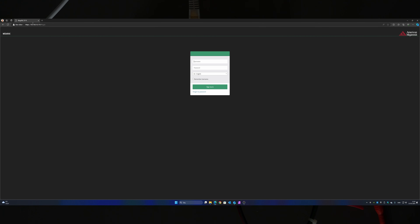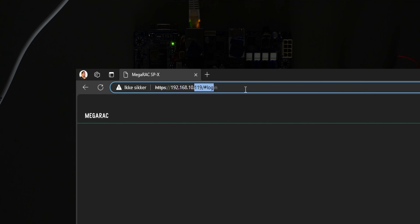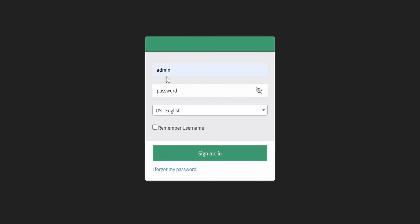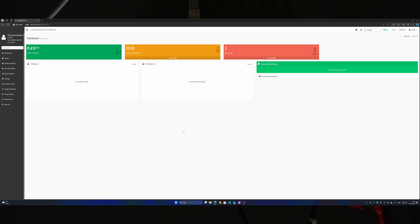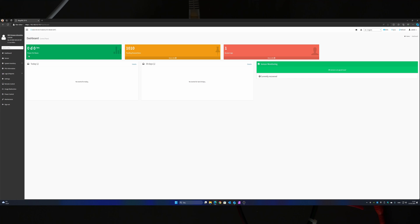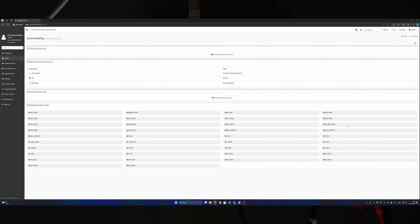I've already built a little adapter to get IPMI up and running. Let's do that now — putting it in, 5 volts going into these cables, and it's active. Plugging in the cables, we should see it booting up. You can see the little LED starts flashing — it's booting, and you can see different flashing patterns. You'll need a network plug. The little IPMI LED will tell you what it's doing even without logging into the interface. I think it's booted up now — two slower flashes and one quick flash. Let's go to the computer and log into IPMI.